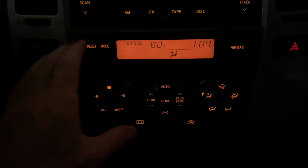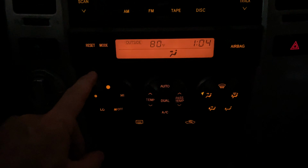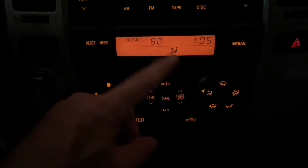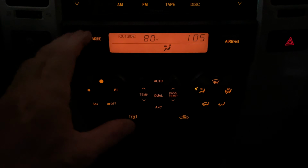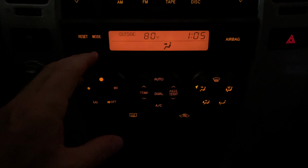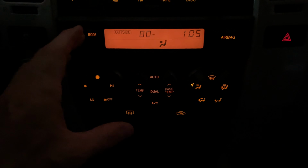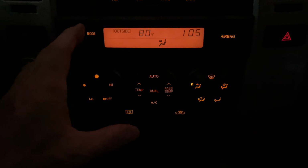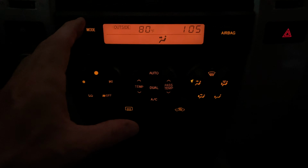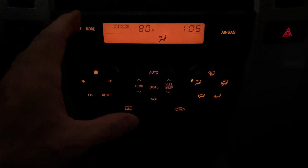And I would definitely recommend just replacing every single one of these bulbs. If you have a few of them that are burnt out, it most likely means that other ones are about to burn out as well. You can always keep your old bulbs as backups in case one of the new bulbs burns out, but we do know that incandescent bulbs tend to fade over time. So not only are all of these bulbs working, they are brand new and most likely putting off more light than the old bulbs were.